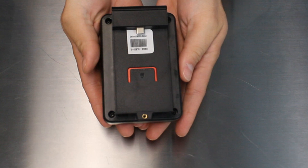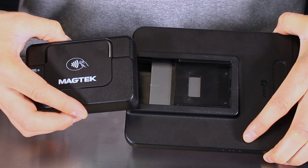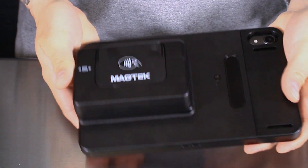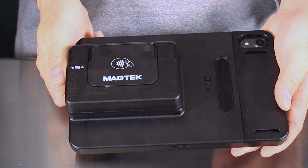With some patience, you'll get it. Now we can slide the assembled card reader cartridge onto the case. Slide the completed assembly onto the back of the case and make sure it's fully seated. Never hold your mobile POS by the card reader. If you wish to detach the cartridge assembly, you must disassemble the case first and remove the iPad to release the catch on the sled.